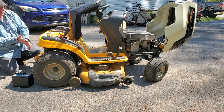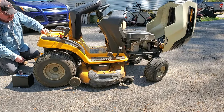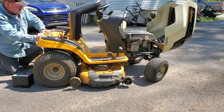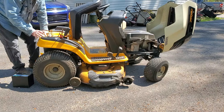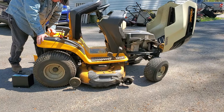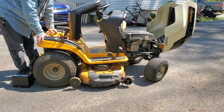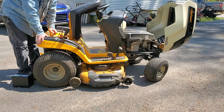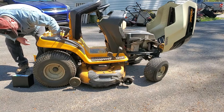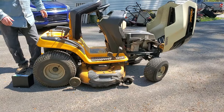The wire that goes to the fuse connector from the solenoid where the battery cable goes to, that wire looks like it's cut, but it's a little green. It's got a little corrosion color to it, so it may have corroded away right where it connects onto the solenoid at the battery cable. And that would definitely give us no power up to the key, because that's what would take the 12 volts up to the key to energize everything. So I have to get a couple other wrenches here, pull the solenoid out, and see just what happened here. This may be fixable.